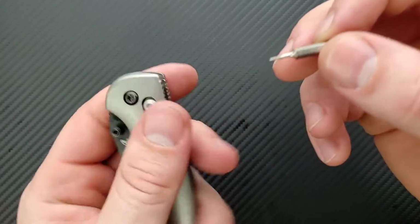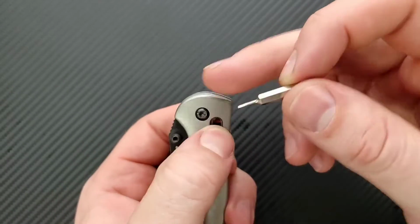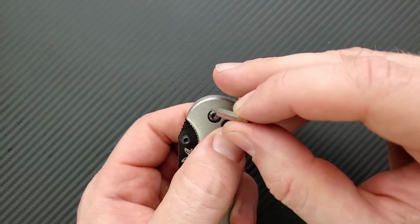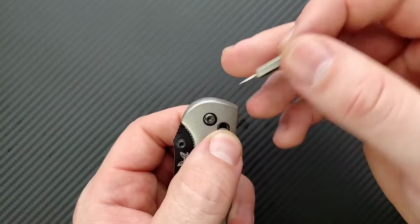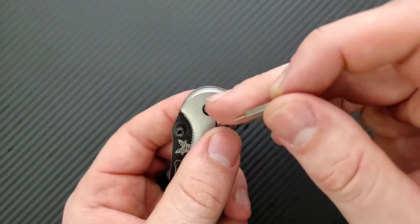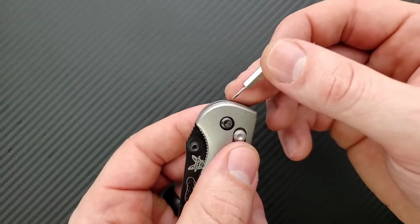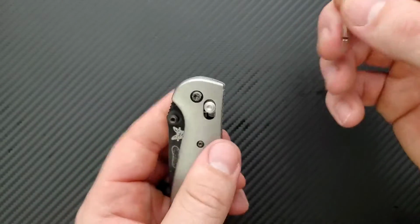And what you do is you got to pull the axis bar down while you're doing this. That's the difficult part, pulling the axis bar down and maneuvering the washer and the blade into place, and kind of taking the tip of this screwdriver and circling everything around so it lines up, and then you push that. It'll finally just click, click, and then you got to move it back down so it's just flush with the top of the blade so you can squeeze that washer in there and then line that up and then keep pushing and messing with it and all that.